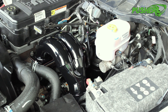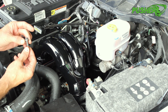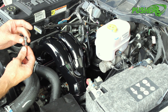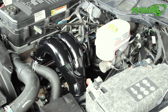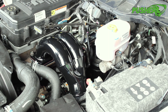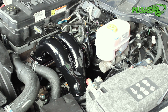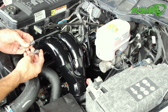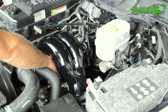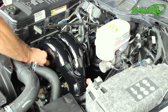A quick note about the flange bolts: on these powder-coated manifolds, we send stainless washers for each flange bolt. This allows the bolt as you tighten it to spin on the stainless washer surface instead of the powder-coated surface, which really helps keep that powder coat where it's supposed to be. Also, the factory manifold had a long bolt that went right through the flow path on the center driver-side bolt hole. Due to the design of our manifold, you can use a short bolt which does not go through the flow path — it bolts down to the flange like the other five. You'll get a factory Cummins-style bolt that matches the other five, accessible from underneath the manifold on the flange.